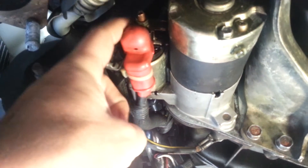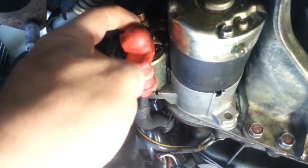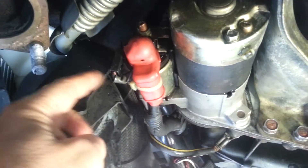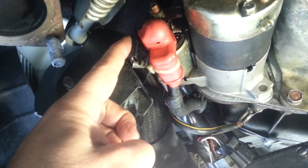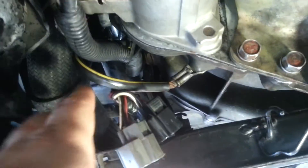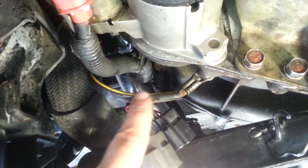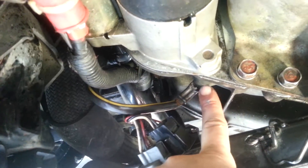The starter has been put in along with the transmission support bracket. I thought I'd leave the cover off so you could see the wiring. Here's the main power, which is almost always in red — it's just got a nut that holds it on to the solenoid. And then this is the energizing wire, it just clips in. And then, like most grounds on the Mitsubishis, they're all black and yellow striped wire — black wire with a yellow stripe — and this bolts into the starter bolt here for your ground.